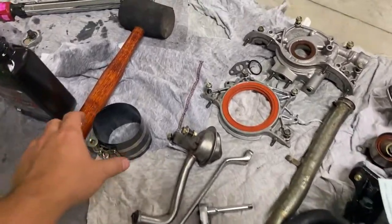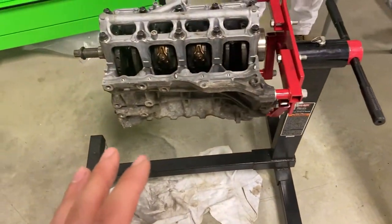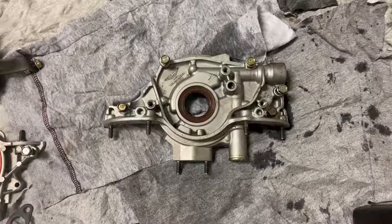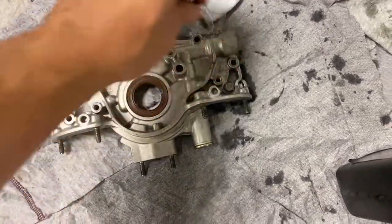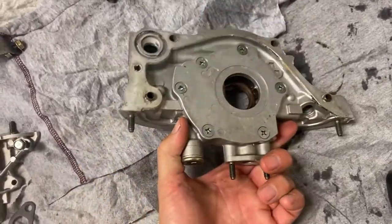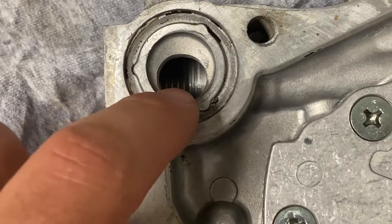All right, this is race-ending if they're not good. Our table's been kind of overtaken by tools, but as far as the inside of the engine goes, that's pretty much it. What we need to do now is put on the oil pump. The D-series oil pumps are pretty small units — really small. So what I did: this hole right here is actually much smaller, so I ported it and made it a little bit bigger, then shaped it so it's kind of rounded on this edge.